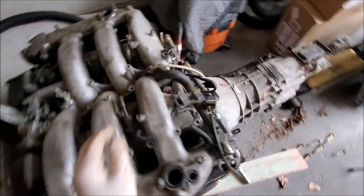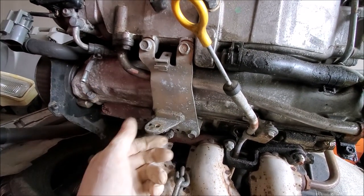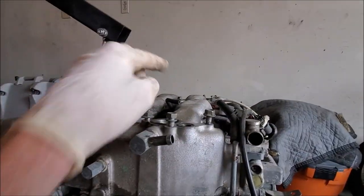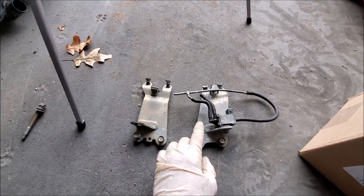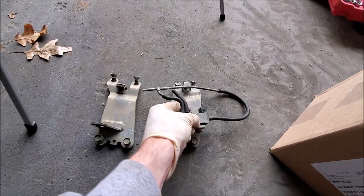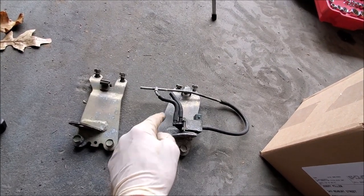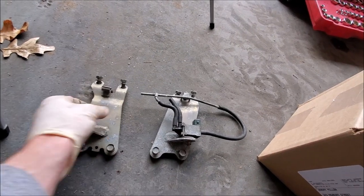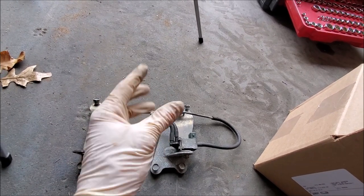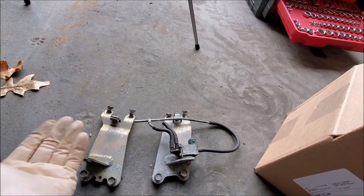You're going to have two brackets on each side — one where the EGR wiring sits. There are four bolts on that bracket, same thing on the other side. This is a prime example of the EGR ports: on the passenger side there's a solenoid that sits on this bracket. The driver side was easier to get to; the passenger side was tougher because there's a lot more wiring and fixtures over there. Once you get these off you can basically toss them — weight reduction.